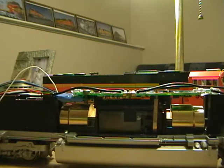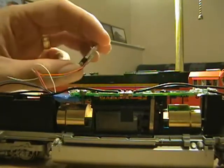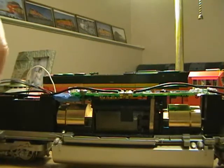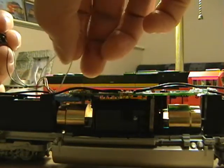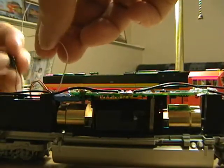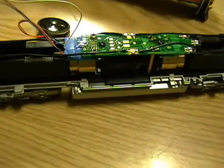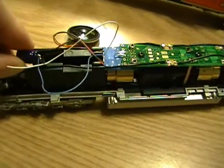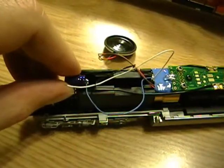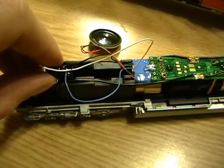Now, there are a set of wires that come out of the SFX-004. Obviously the two wires to the speaker go to the speaker. The capacitor is blue and black, and there's also a white wire. That's if you're installing this into a steam locomotive — it's supposed to help with your chuff timing, and that's this wire here.